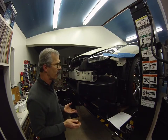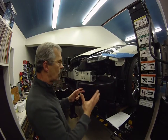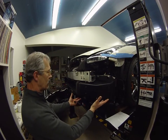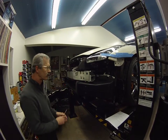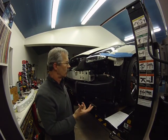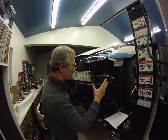The hardest thing was building the framework for it. I got a MoCal oil cooler, 25 row, that fit perfectly in the space behind the duct. I put cardboard on each side of the cooler to protect it, taped it to the duct exactly where it was going to be. Then, with the car down by the ground, I put jack stands underneath and configured it to be symmetrical in measurements from hard points to the other duct. All the mounting points were where the washer fluid reservoir was removed — three of them — and they worked perfectly for mounting all the framework for the oil cooler and duct.